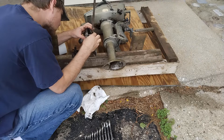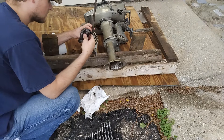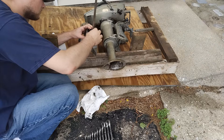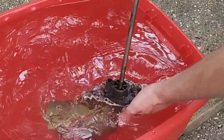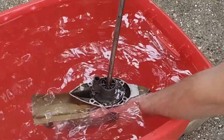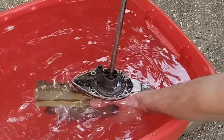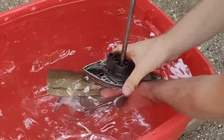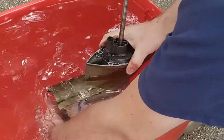So I decided to take the lower head over to our tank and do a little testing — after putting the pump back together by sliding that other part back down the shaft and screwing it in place. In order to test the lower section of the pump in the tank, I needed some way to spin it, so I decided to just do this by hand, spinning the pump really fast. And as you can see, there is actually water coming out of that little pipe. It's really quick in the video and hard to tell, but it is coming out. So I know that the lower unit is functional.